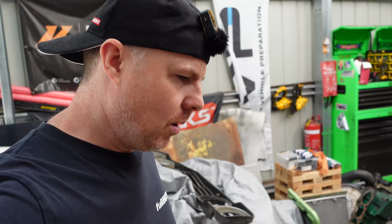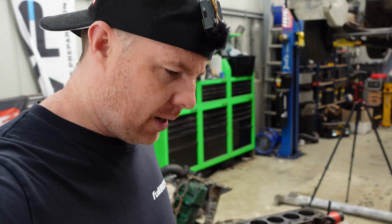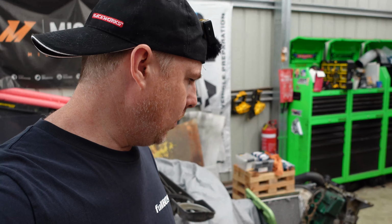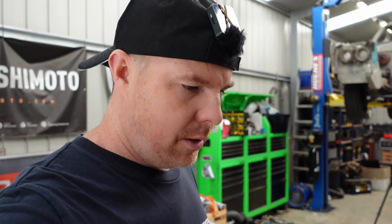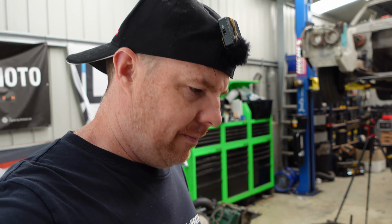So I would say this engine probably had a lot of blow-by and a lot of oil going out the exhaust. What I'm going to do is get the old dingleberry and hone that with the drill, just get some cross hatching back in there, and then throw the standard rods and pistons and rings back in, because it's a pretty low budget engine. I only want to make really low horsepower with it, so I'm not going to bother with machine shop stuff.